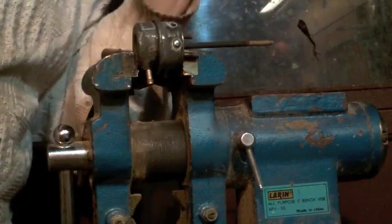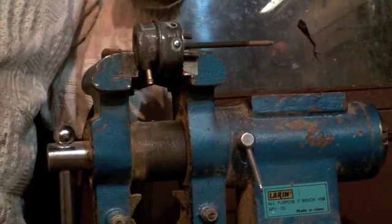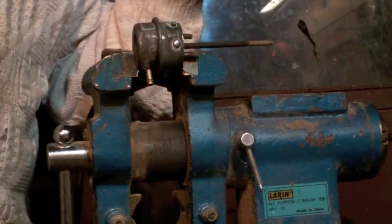Nothing serious — just a series of spot welds. Wait until you can touch it before you move on to the next one. Otherwise you're going to burn a hole in that rubber diaphragm, making everything you just did completely pointless.